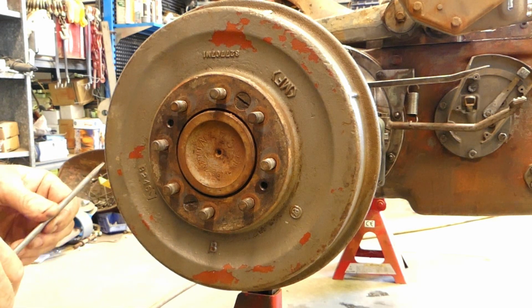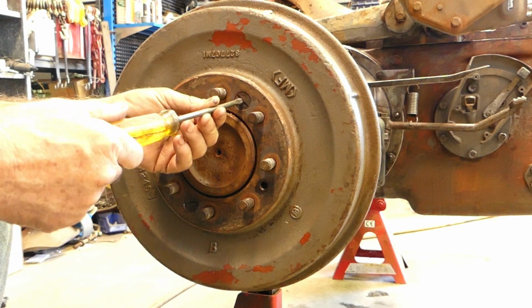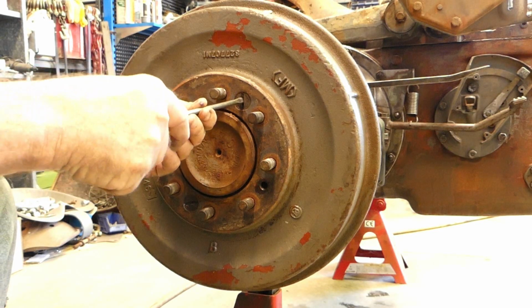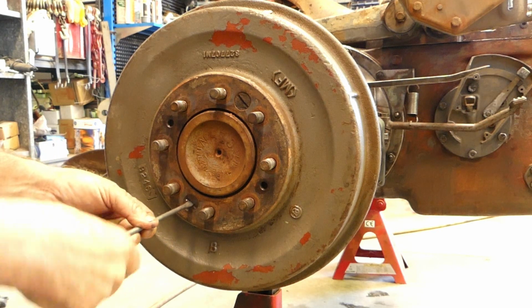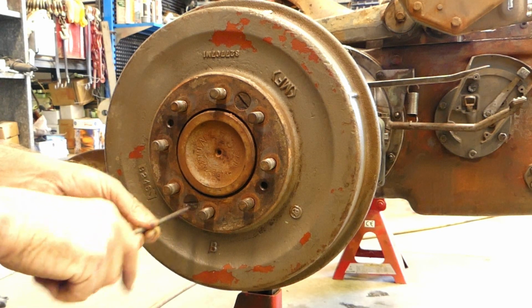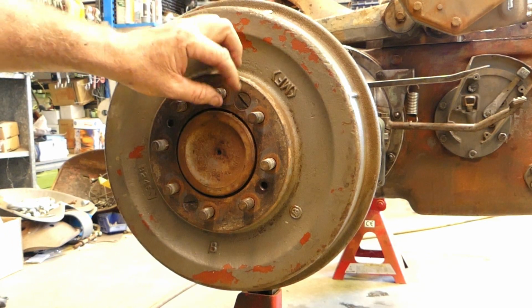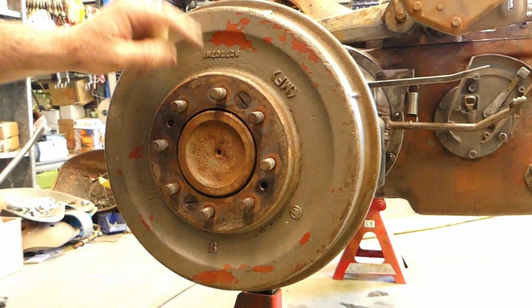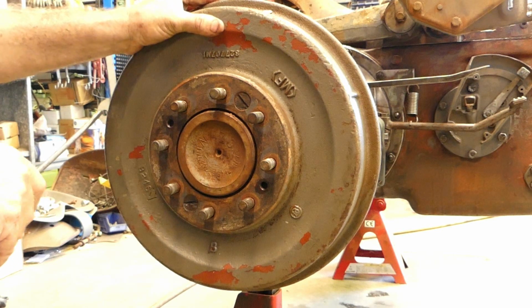If you ever do want to have a look at your brakes, you've really got to work away at these things because they get really tight. So if you take them up tight, just back them off a little bit. It doesn't say that in the book, that's bloody Lance's law. And by doing that, you know that screw when you come to it next time is going to be good. Now we're putting the screws in at this stage, so we know that the brake drum's up firm.